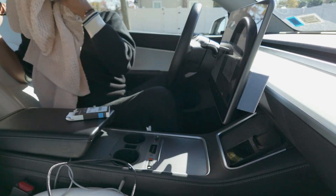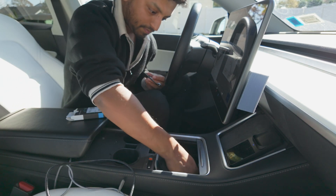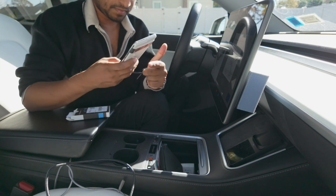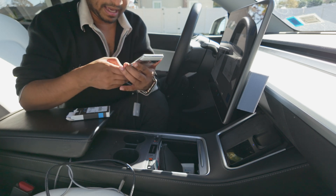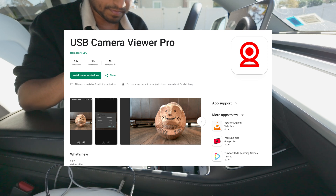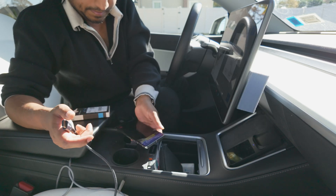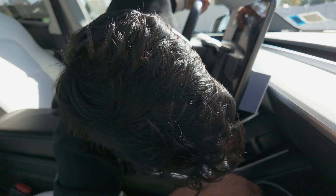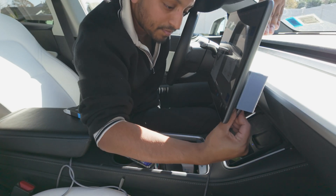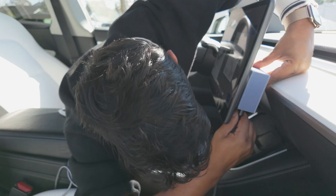With any Android tablet or phone, connect your USB capture card to your phone or tablet — if you have USB-C that'll be great. As you can see I'm connecting it to my phone, and then you have to open the app — the app link is in the description. I purchased two apps and preferred the one linked in the description; it works the best. Now connect the HDMI cable to that modified display at the bottom, and the other end connects to your phone's capture card.